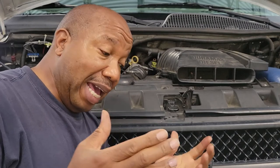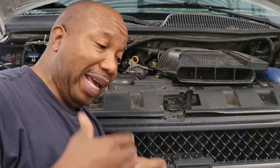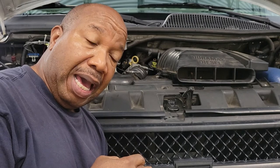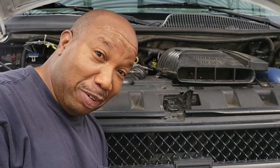All it took was six quarts for me to actually fill up the transmission. You want to check as you go — just start out with five quarts and check your transmission fluid. Do exactly what I did, just go through the gears. Make sure you do not over-tighten those transmission bolts — that is very important because they will break. I hope this video was helpful. Do not forget to subscribe. Take care and God bless.